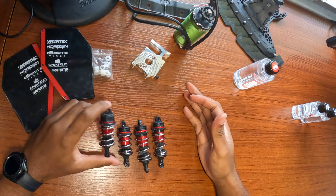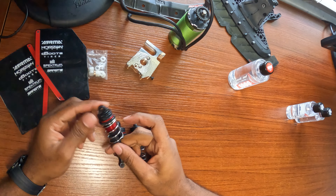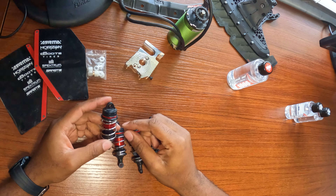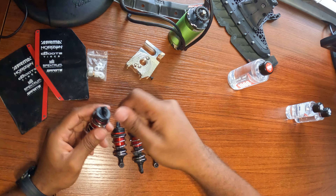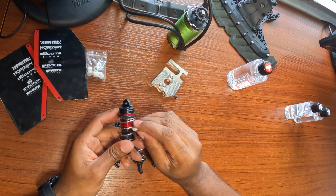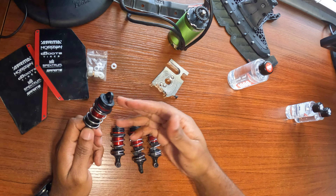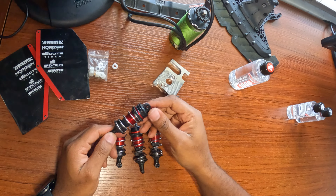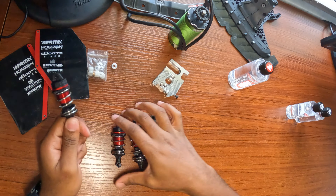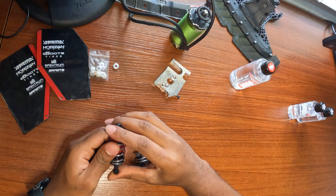I also followed James McCoy's build video tip: use a nylon washer, open up the shock, take off the nut on the shock shaft, put the washer in the bottom of the shock body, and refill it. This helps so you don't have to adjust the droop screw — he goes into detail on that. I did that for the two front shocks and they feel really good.